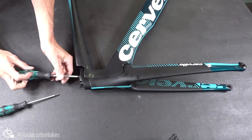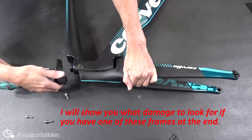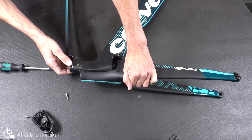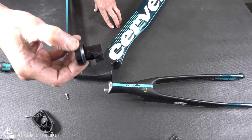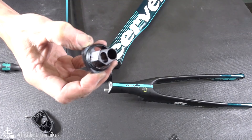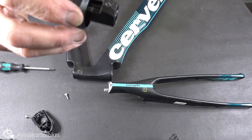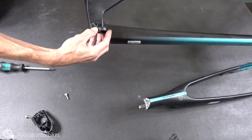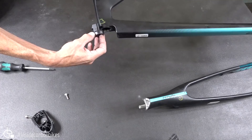There's a whole bunch of screws - three screws at the front. It all attaches that metal bracket. The preload is adjusted with the first screw in the middle, then you pull the pieces apart. The piece that comes out has got a cam lobe on it, and that is what limits the travel on the bike. That piece impacts against the inside of the frame, and you can see it's got hard edges. As it rotates, it can only impact the side of the frame. You can see it lines up perfectly where the delamination and crack indication are on the head tube of the frame - it's clear that that has caused the damage.